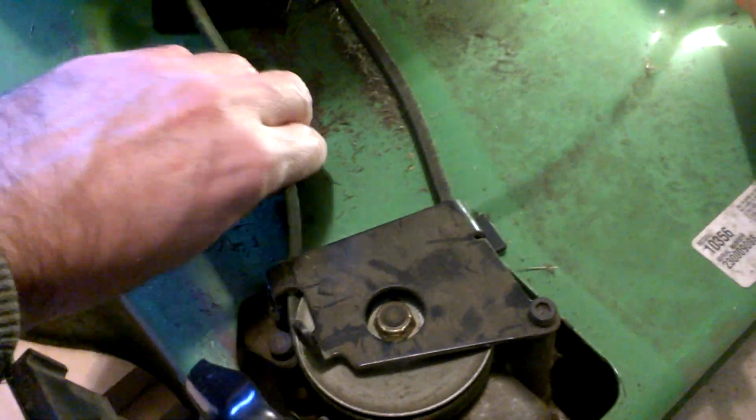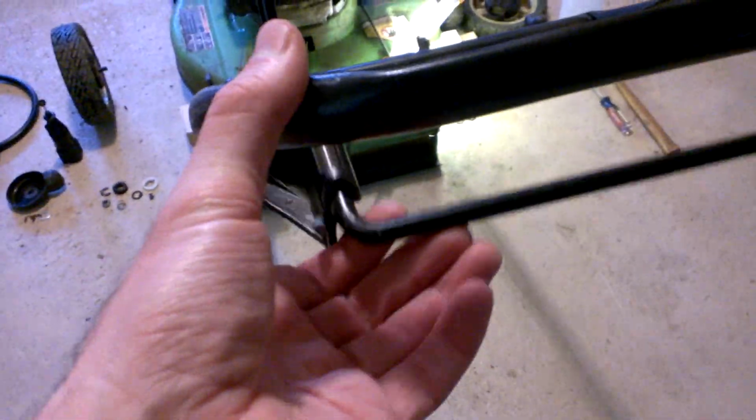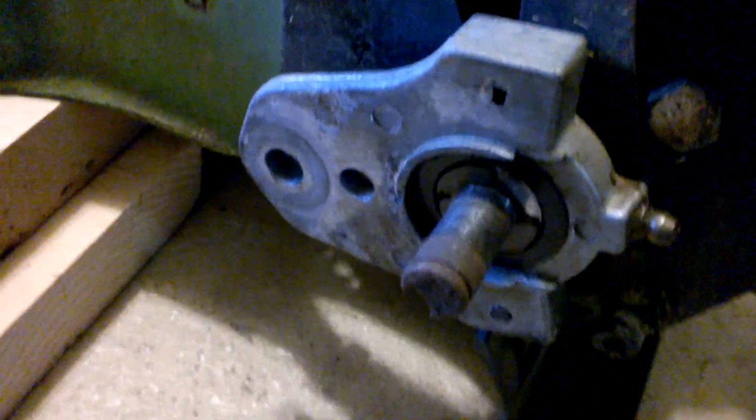I've worked on similar ones, and if something doesn't work, typically it's this belt right here. This belt will be slack. What happens is when you engage this drive right here, it pulls right here, snugs the belt, and then drives a gearbox, which transfers power to these output shafts. You can see I'm spinning this, and as you can see, this is rotating.